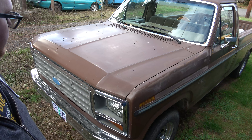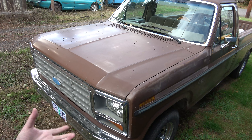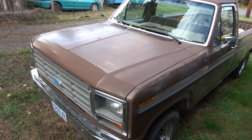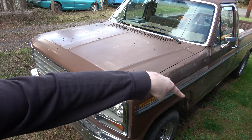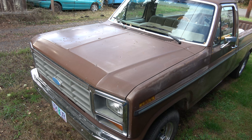My original reason for going to a carburetor was, one, I wanted to be able to tune it. I want to play with this engine at some point, probably next year, probably before we put the five-speed manual transmission in. My original problem with the fuel injection is kind of the main reason why I swapped it — it was not working right. Later I found out it was really because of a bad high-pressure fuel pump along the frame rail — kind of a bad misdiagnosis on my part.